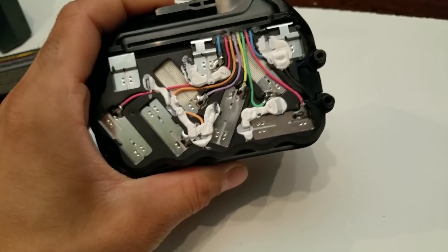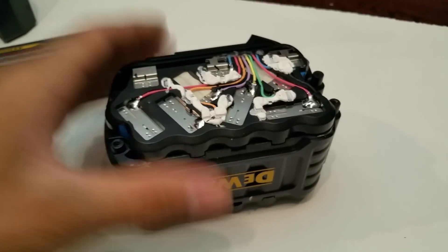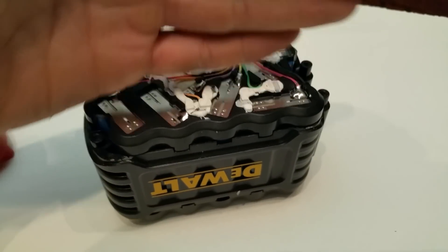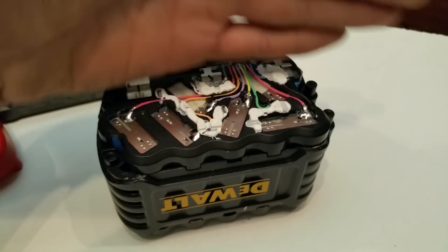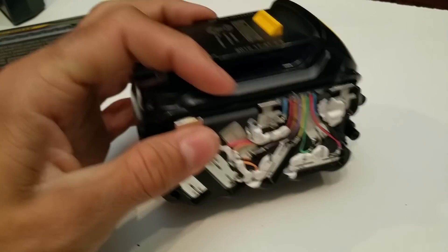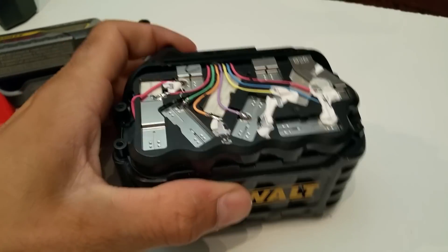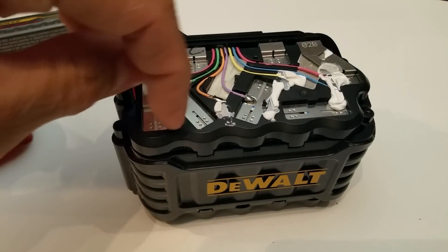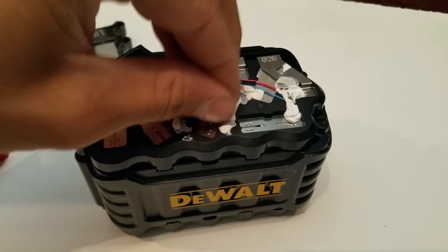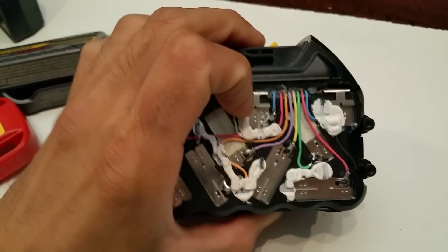I'm not too sure. But the wiring — how the pack is assembled — actually surprised me. I thought it was going to be three 2.0 slim packs joined together: 2.0, 2.0, 2.0 to create this 60-volt battery. But if you follow the way the bars are joined together, the packs are actually in groups of 5. So it's 1, 2, 3, 4, 5 — three times over. This is 2.0, 2.0, 2.0, and you can see that with the three tabs on each side. So these are individual groupings.